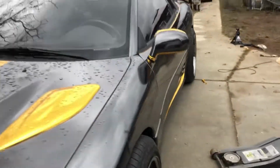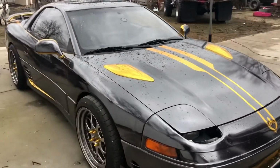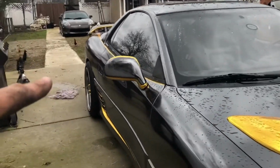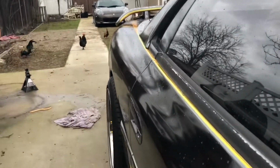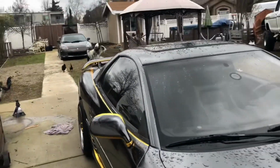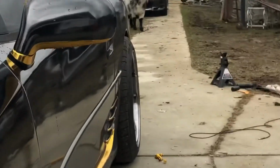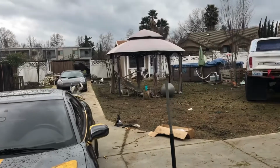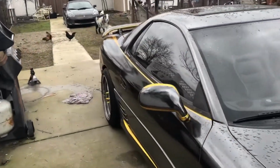Now here, I switched the back end. Remember when I did the whole new wheel tire switch thing? And that back there is now the plus 22 offset. So look at that difference. That's pretty perfect, with just a little bit of poke versus over here with quite a lot more. So that's what the 22 looks like in the back with the 25 millimeter spacer.